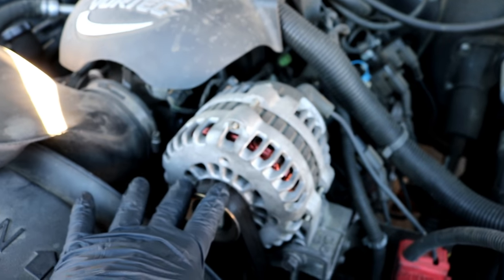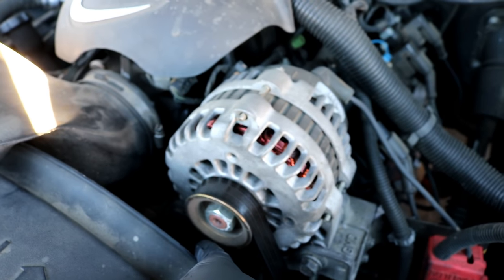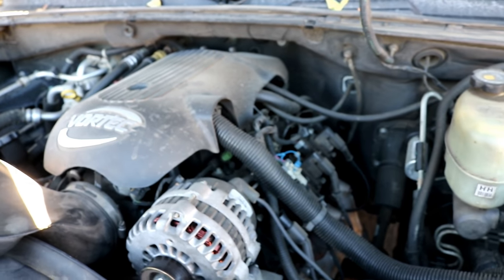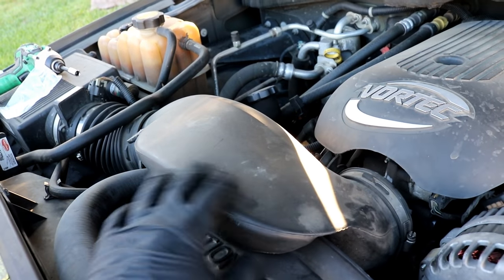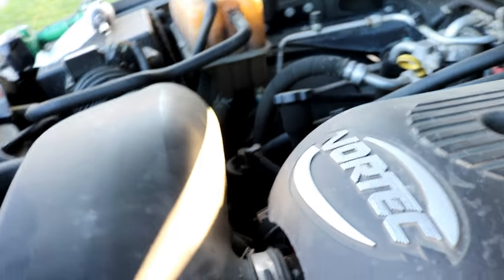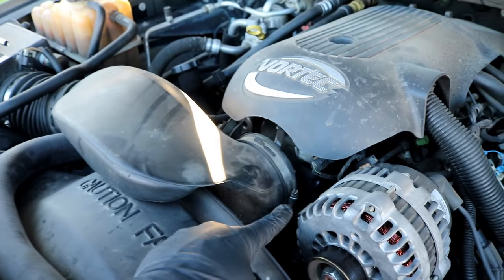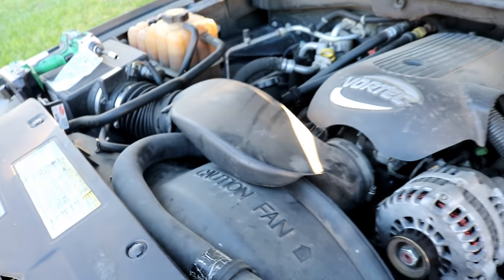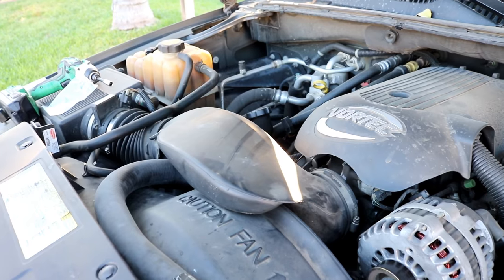The correct way is to loosen up the serpentine belt and loosen the bolt on the alternator — the other bolt on the other side: actually remove one completely and loosen the other, so you can swing the alternator out of the way and have plenty of room to work. Also, take off the air intake tube because it's easier to get to the belt tensioner. It's just an 8 millimeter bolt on each clamp. You'll need 8 millimeter for sure, and a torx set — I think that size is T25.